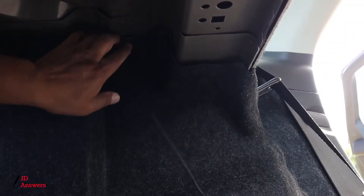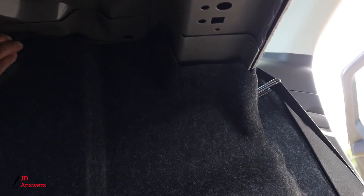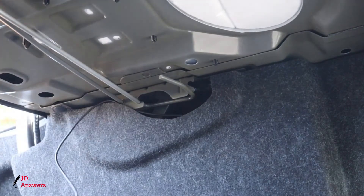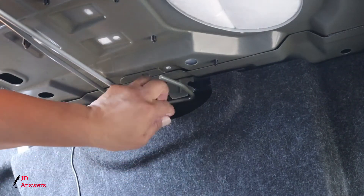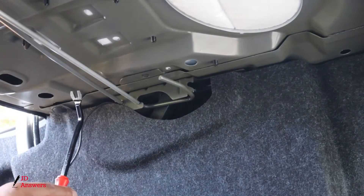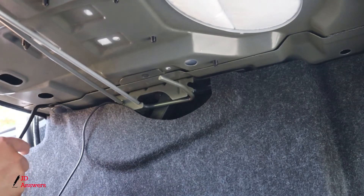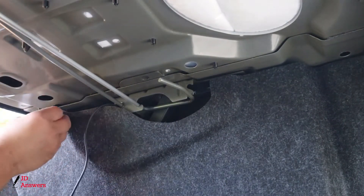For the inside, route the wire here between the upholstery or carpet and the side mounts of the car — pretty much just behind the carpet. Continue around the carpet so it goes to the inside, and put the carpet back — you can't even see the wire at all. Continue running the wire behind the carpet. There's a clip here so use an upholstery remover tool to take it out — I'll put a link in the description for that product. You can see how easy that was to remove.